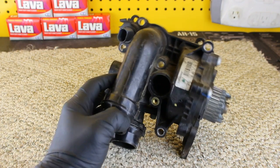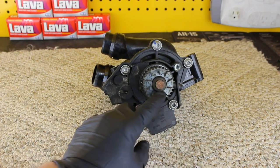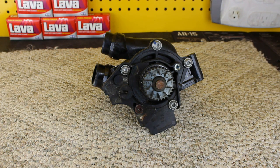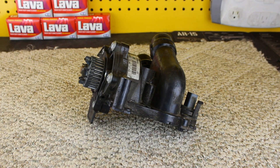I've also read stories about multiple water pump failures on this engine. Here's a good shot of the gear to turn the pump. Multiple failures of these water pumps, and I think it's for a few reasons. One, I think poor installation is probably the most prevalent one. A lot of guys are just jamming these water pumps on, and you really do need to make sure that you're torquing these properly and in the proper sequence — not just zipping them in with your air ratchet. Again, oil leaking down onto the pump up here on the top can definitely cause those seals to swell and cause leaks.